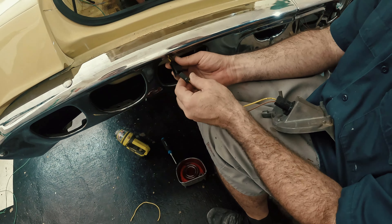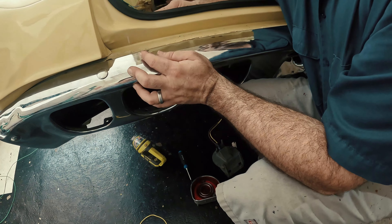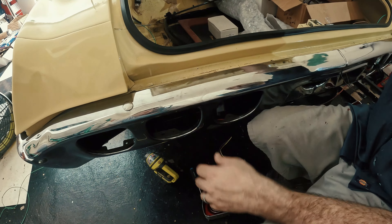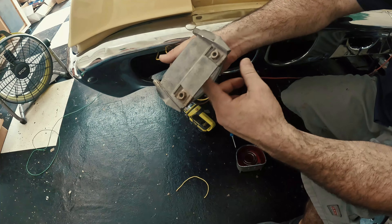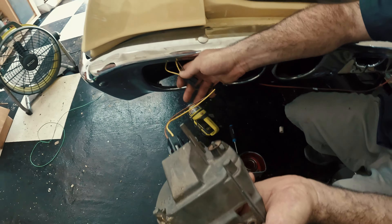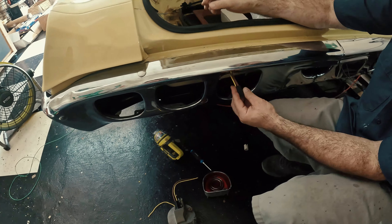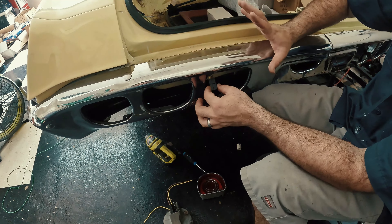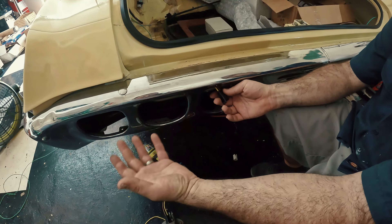Next up is the yellow wire, which is left rear turn signal. It comes from the dash all the way under the carpet back to right here — this is the other side of your light. Your light plugs in, you got a dual filament light or an LED one day. So your turn signal jumps from here — double crimp — to here, single crimp, and that's it. It's a left turn signal, you've got no business going to the right side with it. Really simple.